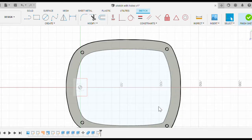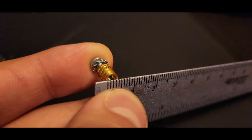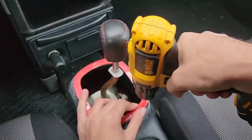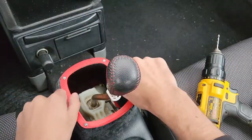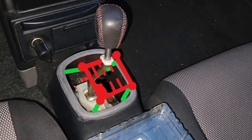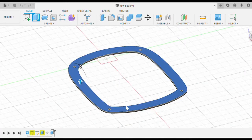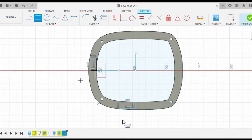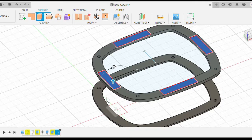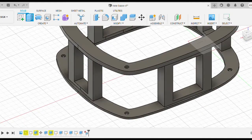The plan is to extrude this profile at the very end by however much is needed to place the shifter plate at a working height. I added four holes for brass inserts which allows me to screw down the model to the console. After confirming a good fit, I need to geolocate the boundaries of the shifter at the point where the shift forks would not interfere. I chose a height around that white nylon piece, as that's where the shifter stick straightens out. Moving the shifter to the nearby gears I saw about half a centimeter of space between the gates — good enough for the steel forks. The height of that plane with reference to the center console opening was about five centimeters. I then extruded the model five centimeters upwards to mount the entire piece to the console and map out the exact boundaries of the shifter stick. This gives me an accurate location of the top opening of the model in reference to the base drawing. I cut out some material on the sides to save on filament and then printed the piece.